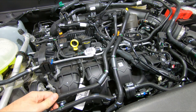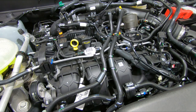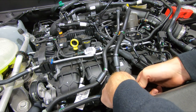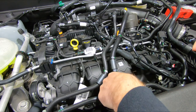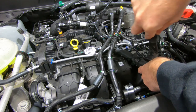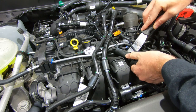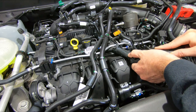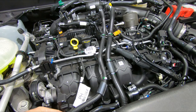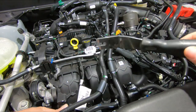Where these EVAP lines are, there are pins. Take our clip tool and pry those out. This connection here — you can see this little tab, you just kind of wiggle past it. It's almost in foam and that pulls right off. For our wiring harness, get our clip tool behind it and pull it out. There are a few of those like that.